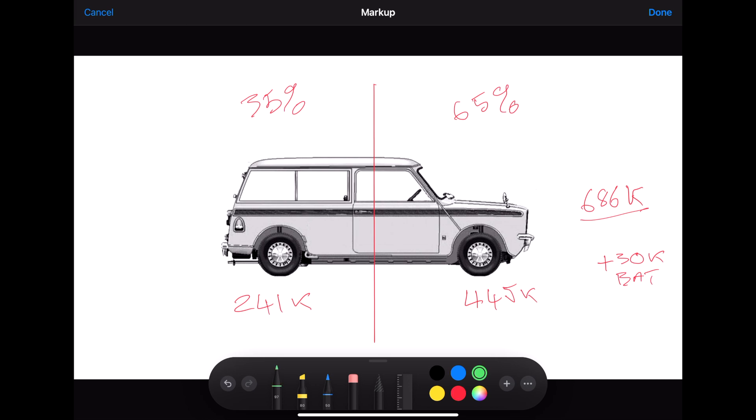If you look at the battery placement, you'll see we're putting a range extender battery behind the rear seat or underneath the rear seat, and we're doing one in the base of the cargo area right here. Because the electric motor on the front is lighter than the combustion engine, but we're shifting weight to the rear of the car, we're probably going to end up with something more in the range of 50% front and 50% rear. That actually makes a difference to the dampers — effectively what we're doing by changing the dynamics is changing the load on the front: we're lightening it but increasing the load on the rear.